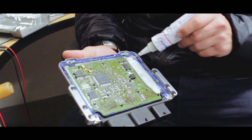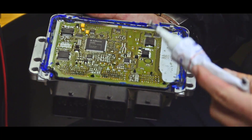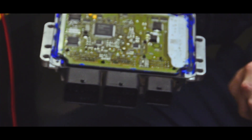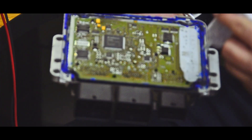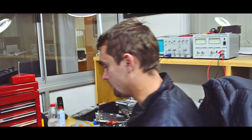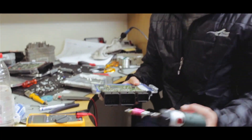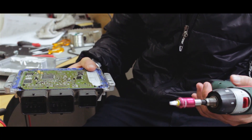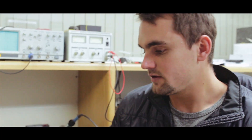As you'll see, there's a silicone line here when you open the ECU. It's very important to seal the ECU up again, and we use this Bostik car silicone — it just protects the ECU from water damage. If you don't seal it up properly, you'll end up getting water damage on the ECU, which is obviously very bad. Then you have a normal drill for opening up the ECU — we'll find one that's closed and show you how the opening-up process works.